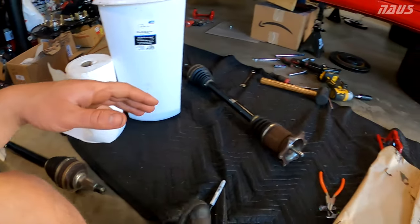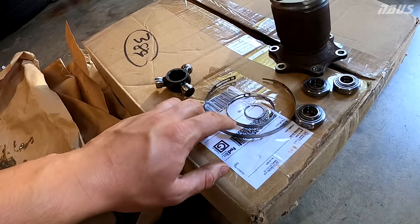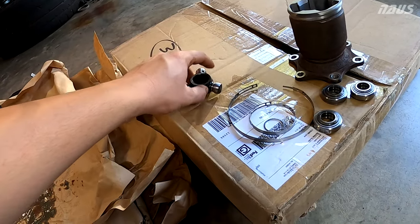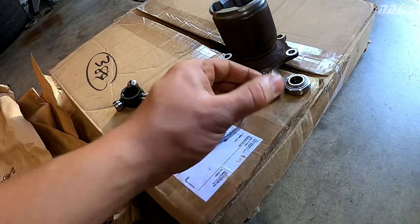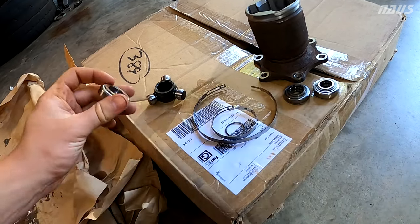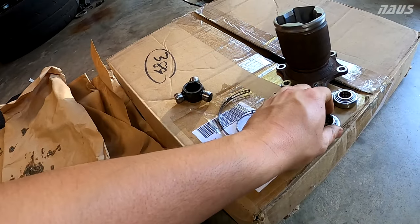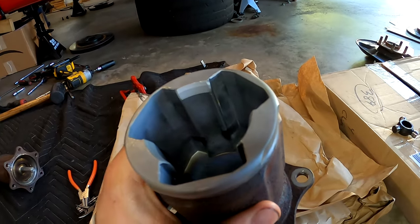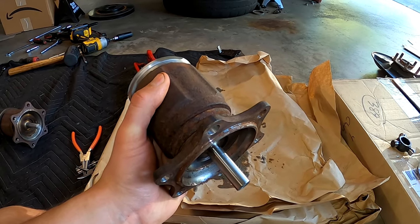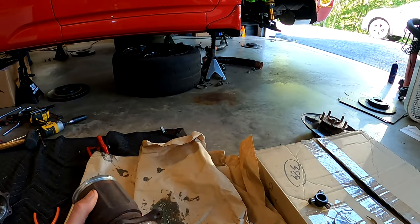This is my first time ever taking one of these apart. These are both clamps for the CV joint. This is the clip that keeps the yoke on the spline shaft, and these are your bearings. This is the side that has a large flange — that side installs inward. When you put these back, make sure you do it the correct way. Here's a quick look — this is mine, the driver's side, the side known to have all the wear on the car.